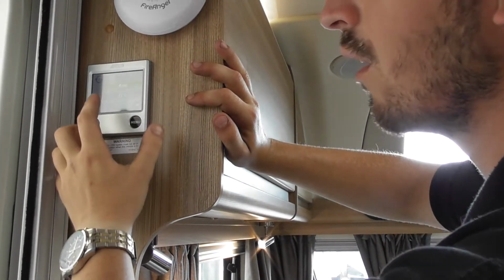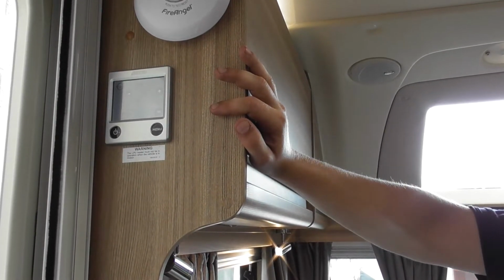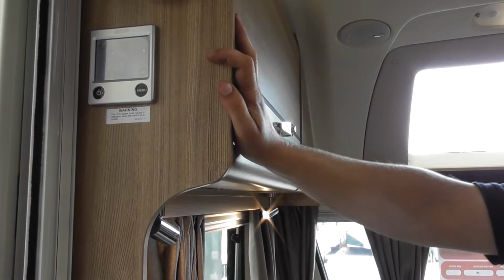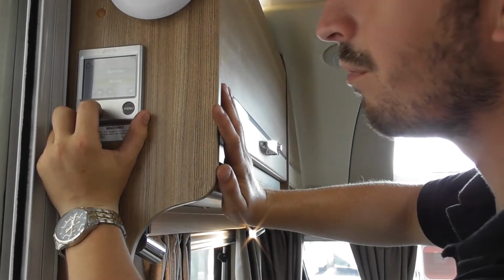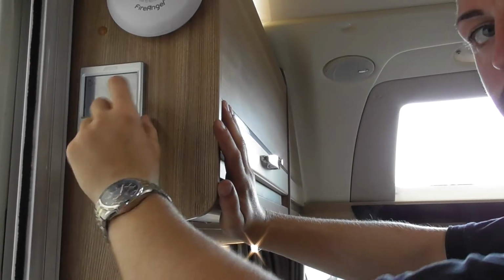The next one is how powerful the pump is. So the pump's currently on 5, so that means it'll go flat out sending it round the van. So if you're freezing and you ask for heating, it will not take long. That one is summer or winter. If you put it on summer mode, you won't be able to use the gas, so leave it on winter mode.